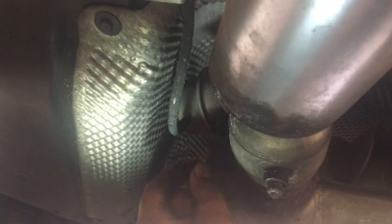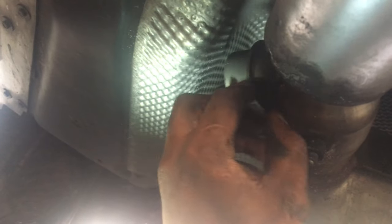There we go — the exhaust is starting to move. Just swing this out of the way and off to the next side. With this one unscrewed now, just go ahead and flip this out of the way. Also on this side of the edge there's an actuator for the exhaust flap — you're just going to go ahead and pull this out. It's pretty brittle so it broke, but no biggie. It's long enough so it can always go back in if need be. You can use a razor to cut it and take it off, and then reattach it if yours ever breaks. This just has to be disconnected.